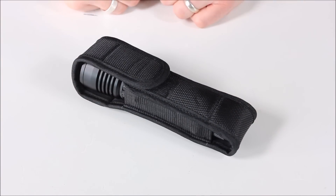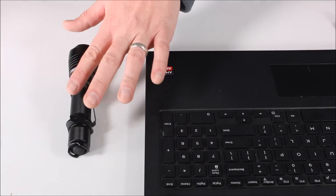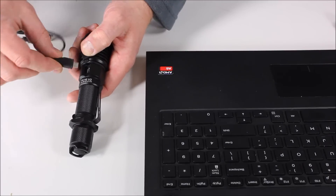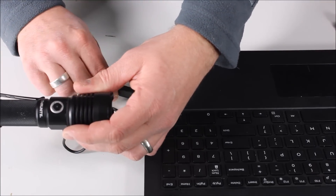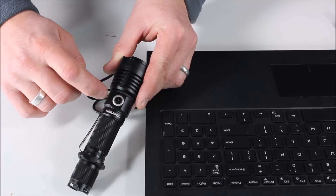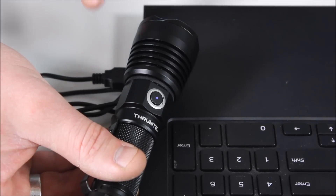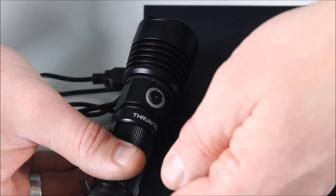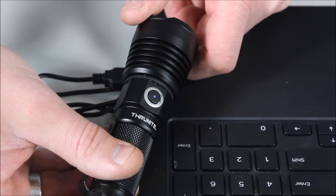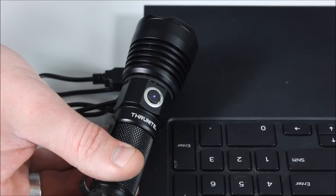That's a look at the light here in the studio. I want to talk about the charging process. I've got my laptop here. We're going to pull back that little rubber tab, plug in our micro USB, and plug it into the computer. Now this little purple light inside that ring is going to start flashing. I'll zoom in so you can see what this looks like. The purple light is flashing because either it's not properly plugged in, or if I haven't depressed that end switch, it's not charging. So when I click the end switch, you'll see it stops flashing and starts charging. When the purple is steady, it means it's being charged; when it's flashing, it means it's not charging — there's some sort of issue.